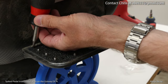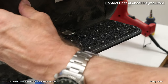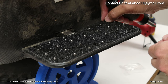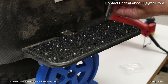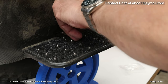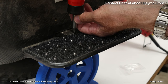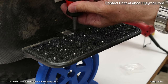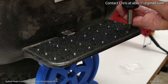When you install these screws, don't tighten them down — just loosely install each one first. Because there is a little bit of variance between all the Gotway — you know, high-quality Gotway quality control, right? So there's a little variance in the placement of these holes. To get the pedal inserts to fit nicely, just install all of them a little bit, then go around and tighten them in turn, and it should come together nicely.